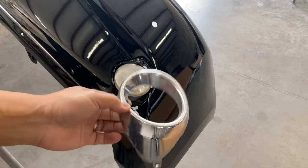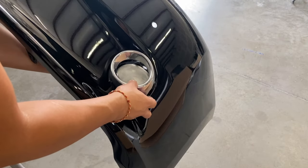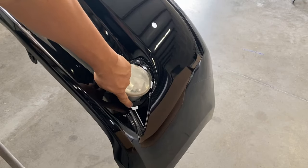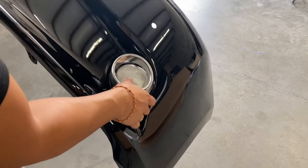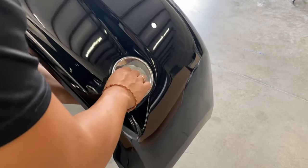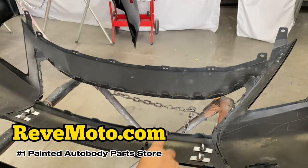All right, so now we're gonna go ahead and put that chrome bezel in place. So basically just go ahead and make sure these tabs right here line up with the hole right here. And you should be able to just press down on it like that and just tug on it, make sure it's secured. All right, so now you're gonna flip the bumper upside down again,